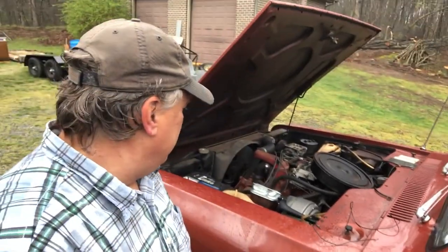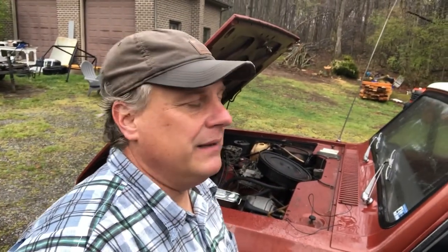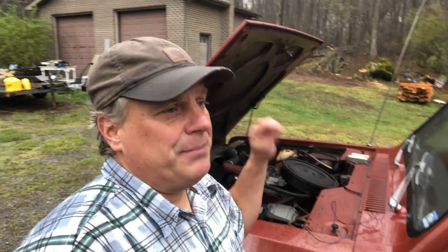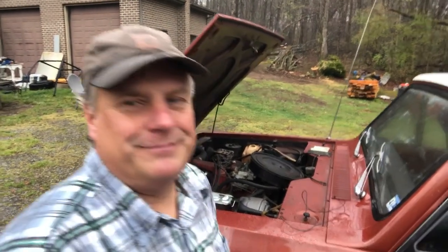But the whole end of that radiator is corroded down the side. And the odds are I'll probably end up having to go back with one of those new aluminum ones. Actually, there's a guy up in Wytheville, Virginia, a couple years ago, was up there, and he still does recoring of radiators, so I might check in with him about having it recored. But regardless, a little bit of stop leak in there might get us a little further down the road and back. So I probably will pick up a jug of that.